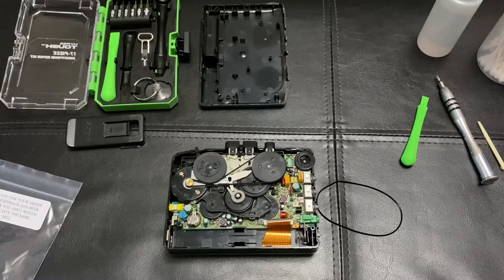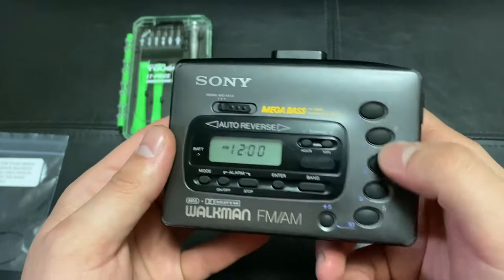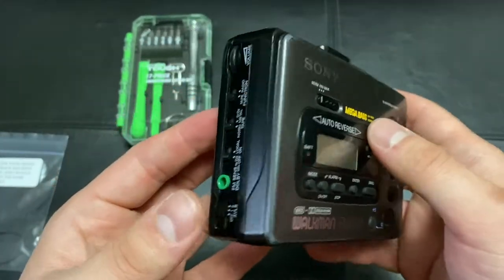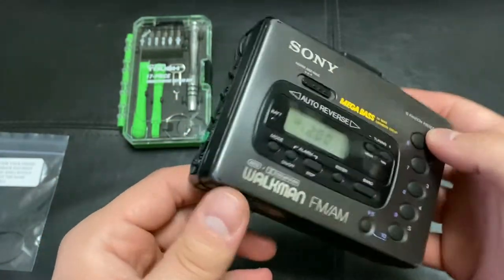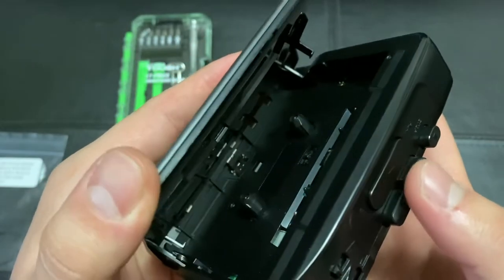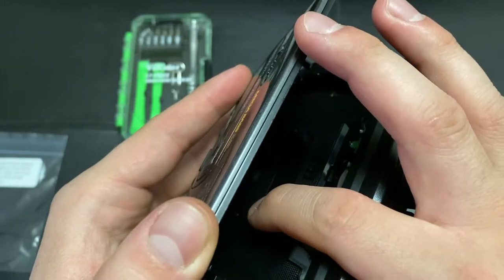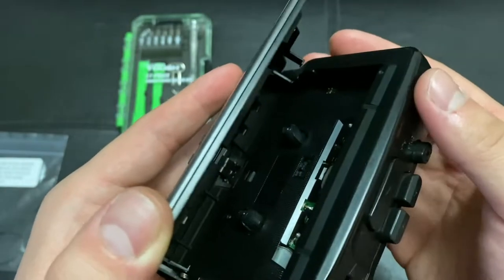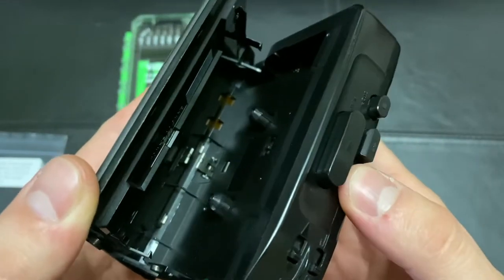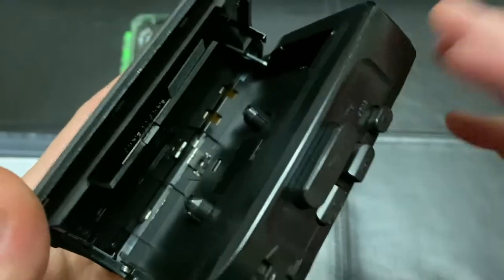That's as simple as it is to get a working Walkman again. I got it all put back together with batteries in it, and it's nice to have the digital tuner. Obviously I have to reprogram it — each time you take the batteries out it loses its memory after a while, not sure if the capacitor went bad or it was just designed that way. With an actual cassette it puts a little resistance, but I'm pushing down on it and I can feel it's still moving at the same speed. Before, it would just come to a halt when you put a little bit of tension on it.